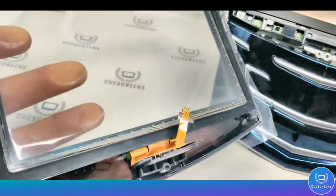This is another step that trips people up occasionally. When you route the ribbon cable to the back, make sure it goes through the upper slot — it's much larger and wider and is the correct location. Sometimes people try routing it through the small sharp area and it causes the ribbon cable to tear, so avoid that.